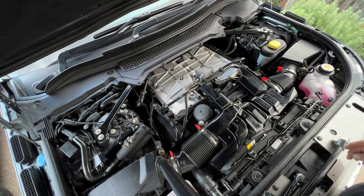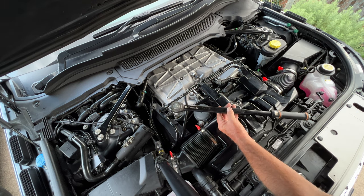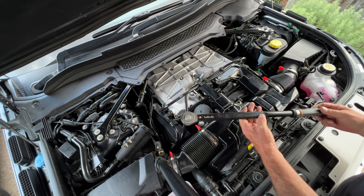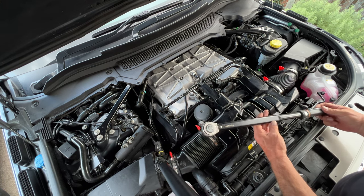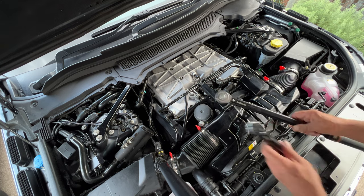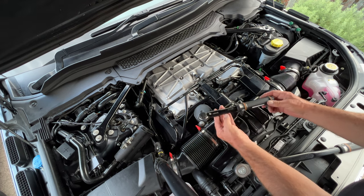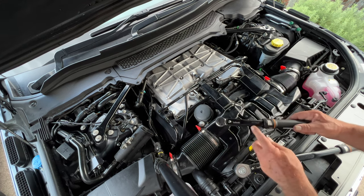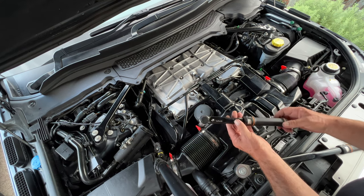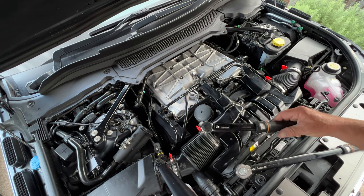Now, over the years, you start collecting nice pieces of kit. And one of the favourite kits I've got is a torque wrench. This one is doing the wheels. 300 Newton metres that goes up to. I work in Newton metres. That's the wheel one, and that one I've used for about 5 years, 2003 actually, that's an old one. But that one I get recalibrated every 2 years. Chap comes around from Snap-on, recalibrates the torque wrench. That one goes from 8 to 60 Newton metres.